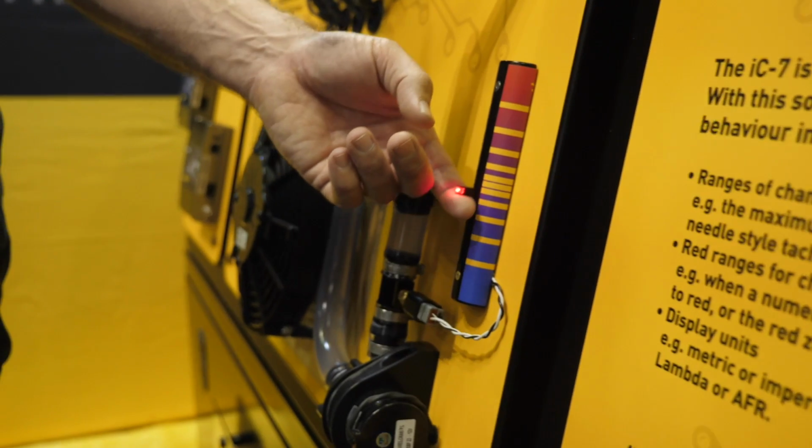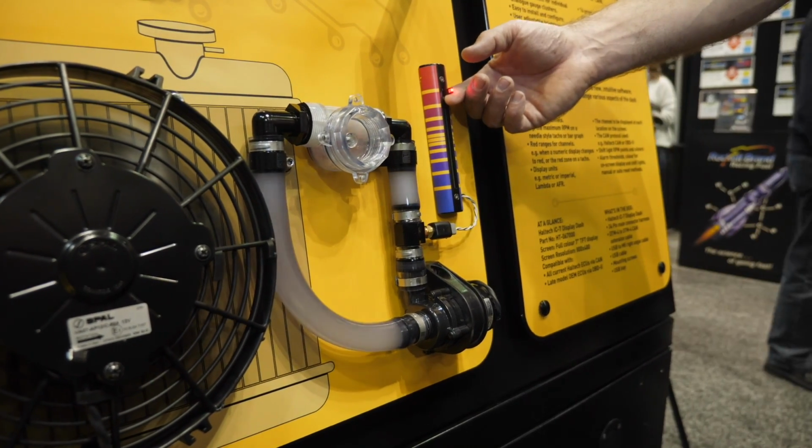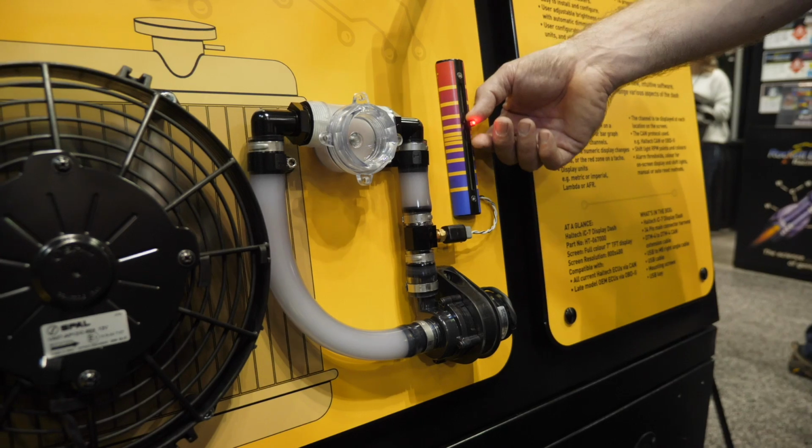I actually do that on my daily driver. I run my thermofan as a variable duty cycle against coolant temperature, so it just sits wherever it's happy, and it's nice. It's cool.